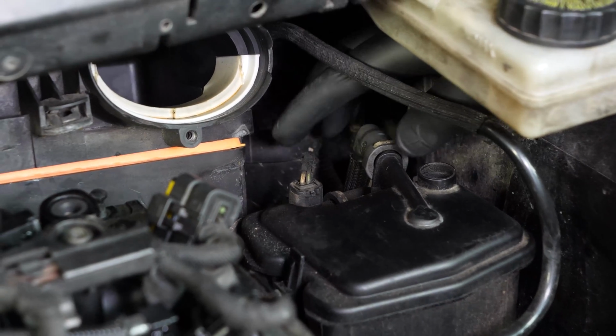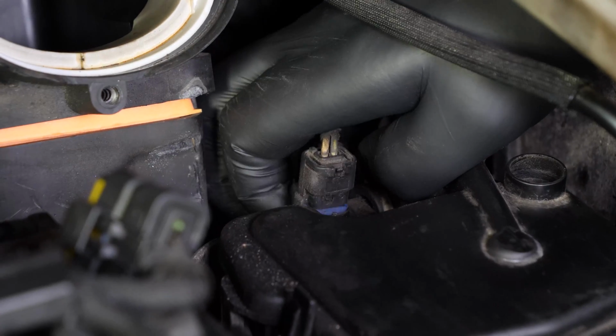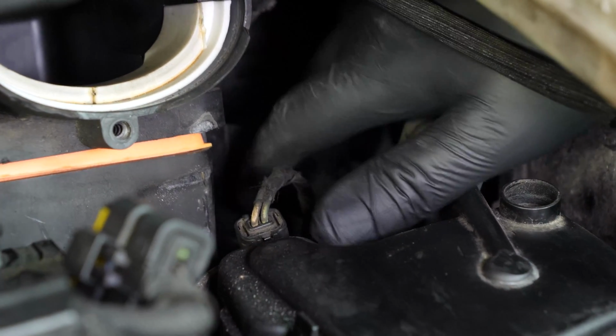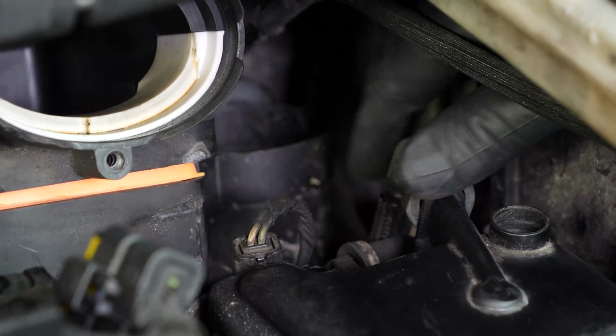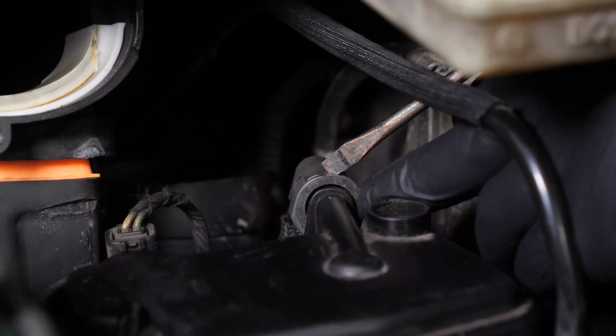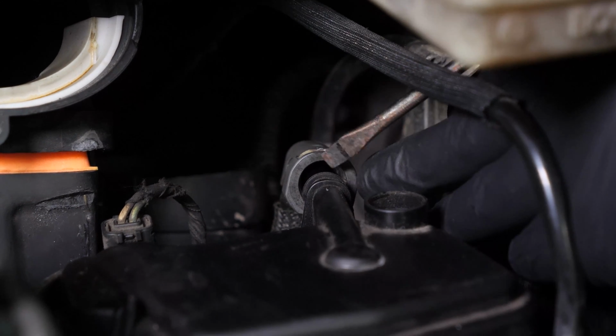Remove the electric connectors by lifting the holding spur and simultaneously pulling the terminal upwards. You must now unclip the diesel filter hoses. Push on the 2 pipes located under the filter, exerting pressure on the white collared part.